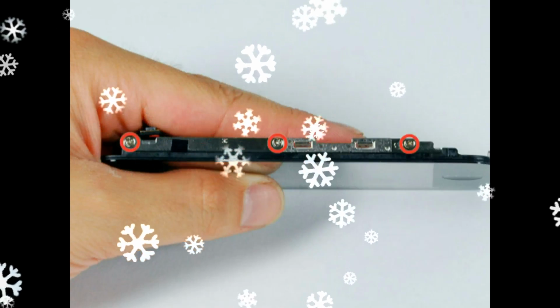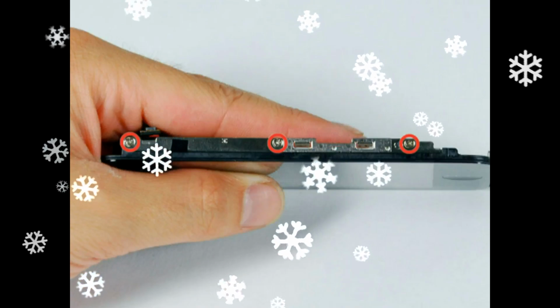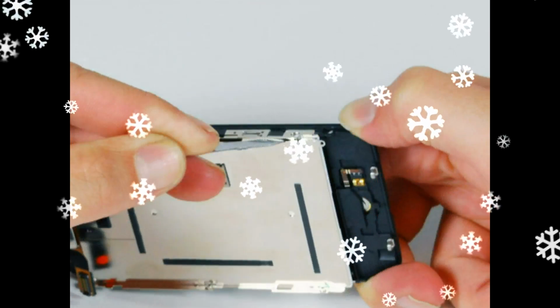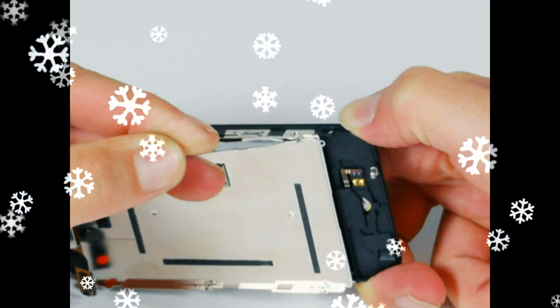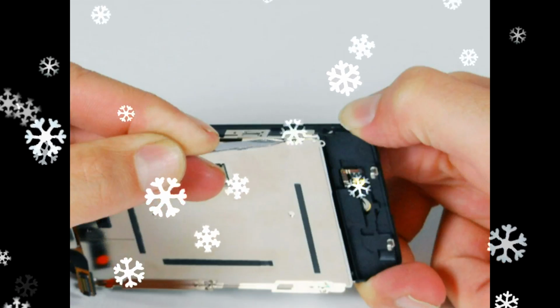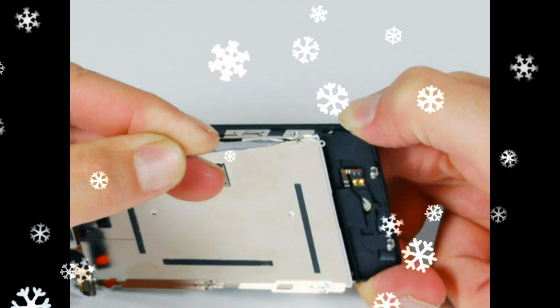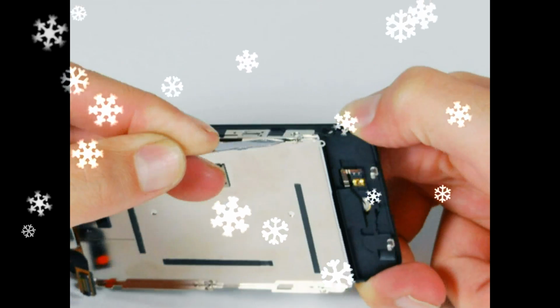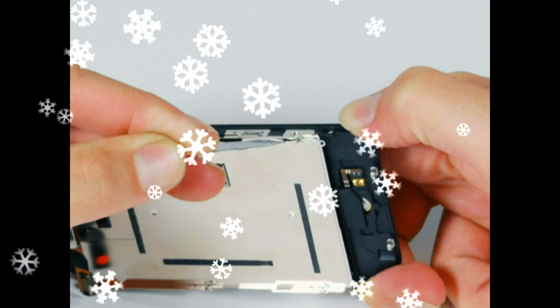Place custom fit adhesive strips. Stick double-sided tape on the upper area of the front panel plastics. Use the flat end of a spudger to press the adhesive strips to the plastic frame. This will clear out bubbles and ensure good adhesion. Place the second adhesive strip, a double-sided tape, on the home button end of the front panel frame. Run the flat end of a spudger over the strip to stick it down and push bubbles out from under the sticker. Good adhesion.